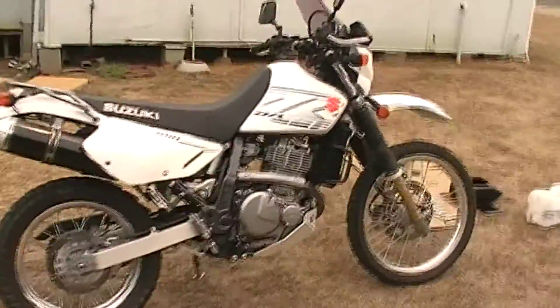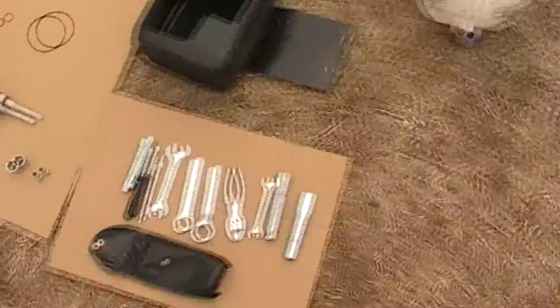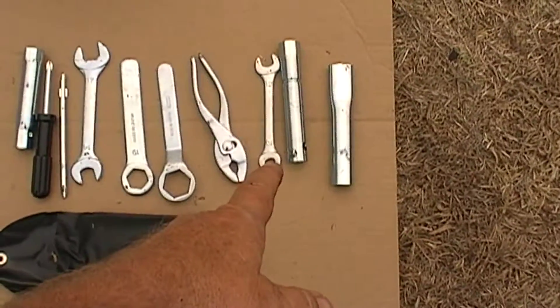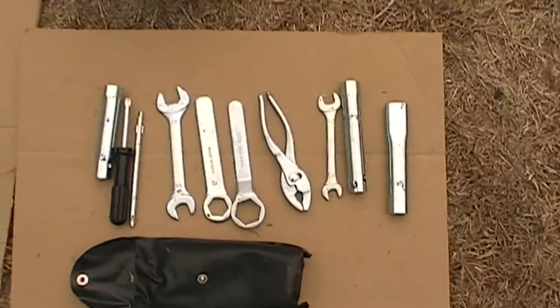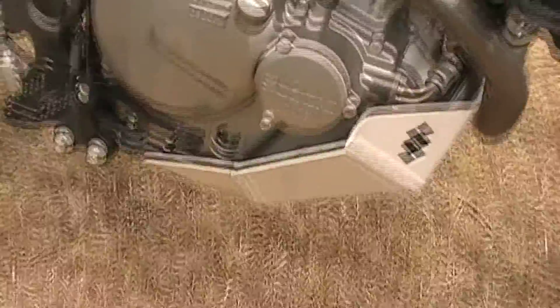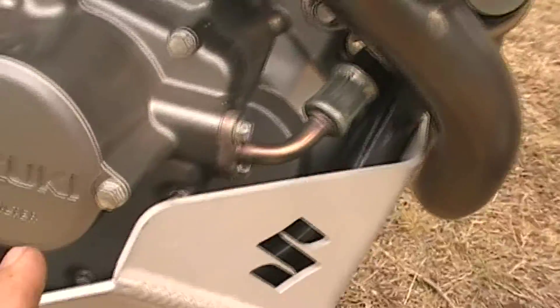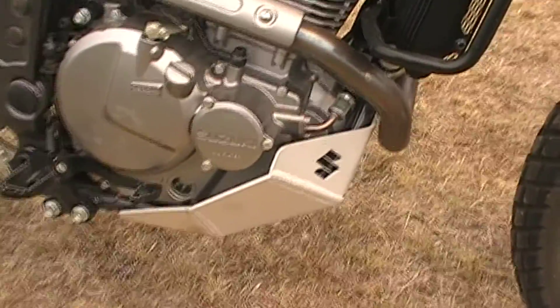So that's about 15 minutes of warm up time. Now I'll show you what I've discovered. The smallest spanner we have is 10mm, and 17mm is the supplied spanner for the sump. But with a bash plate on there, you can't get your 17mm spanner up underneath to get in the hole. So I'm going to have to use a socket. And these are 8mm, so I don't know how Suzuki suggests we get that all apart while we're out on the road.